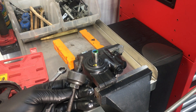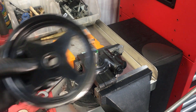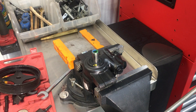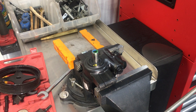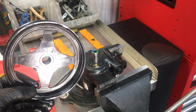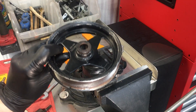Over time a lot of these installers break. An old guy told me a long time ago to actually take the pulley and grind out the inside just a little bit — take a little material away with a sanding disc — and that will help make sure the tool does not break. I prefer not to do that, but I may do it just a little bit depending on the corrosion. Besides that, we'll take the cleaned-up pulley and press it on.